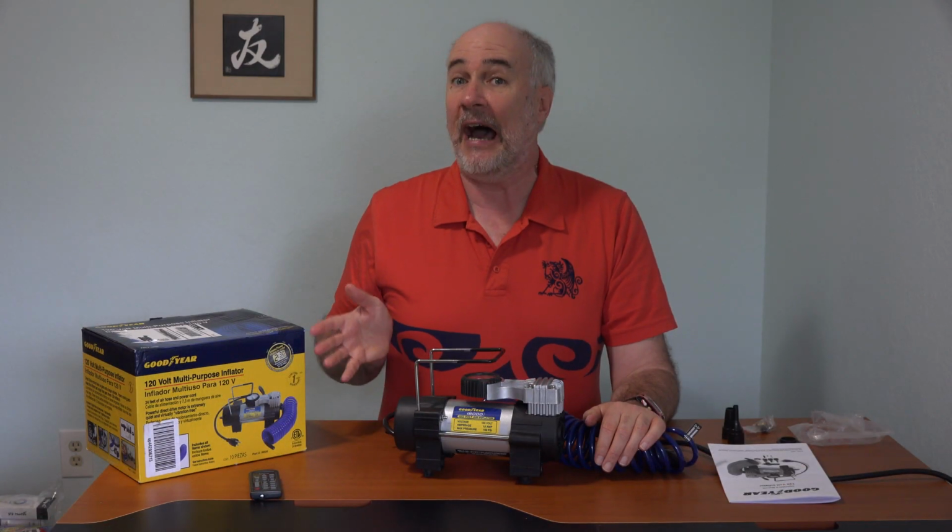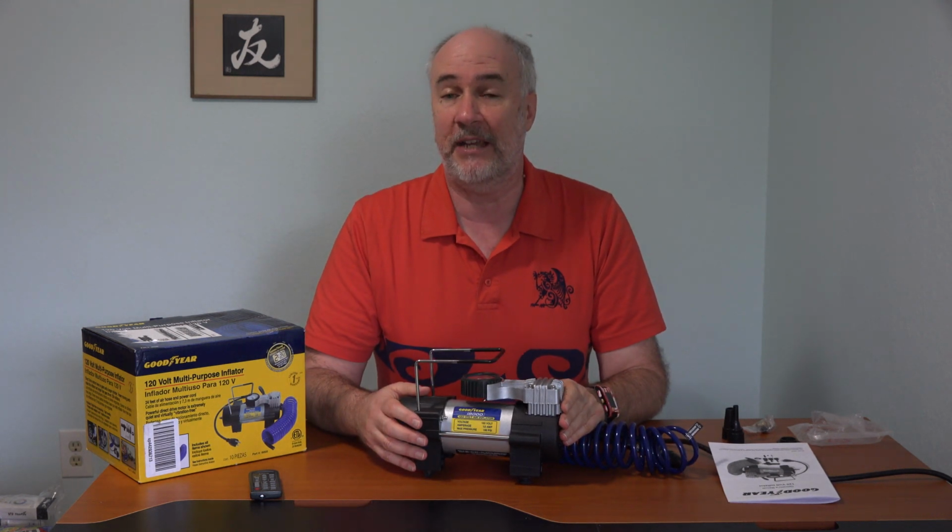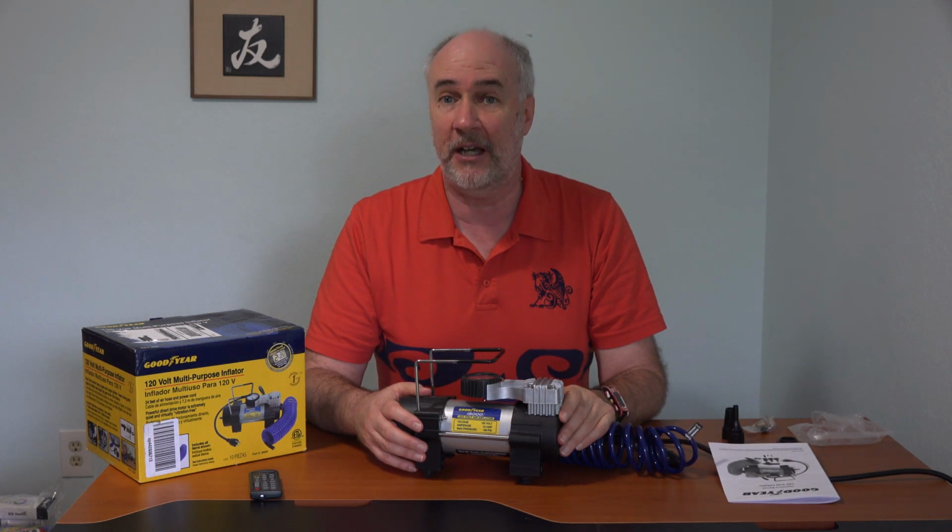So that's the Goodyear i8000 air compressor. I bought it online for about $50. If you can't find it in your local auto supply store, I'll put a link to it down below this video. I did want to mention that this never got hot in the whole time that I've used it. Even when I was done topping off the tires, it still is barely warm. Now they did say if you're using it continuously to inflate at pressures over 70 psi, after 10 minutes of that, you got to give it a 10-minute break to cool down.